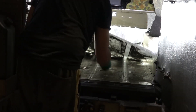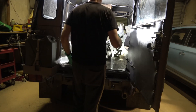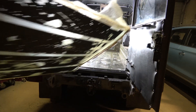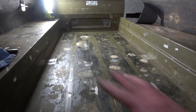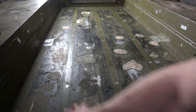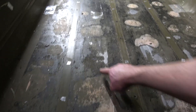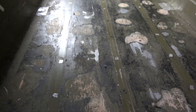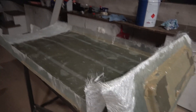The fiberglass resin had obviously reacted with the Land Rover's paint. After a bit of releasing, weirdly it's reacted only where it must have been resprayed in the back at some stage, over the bed rails, because the original paint hasn't reacted to the fiberglass resin but the new paint has. Different paint obviously. So that's the bottom bit of the battery box - it's a start. I can put that back in and do more fiberglassing, but I won't have trouble releasing it now.